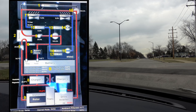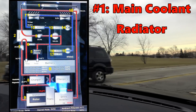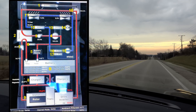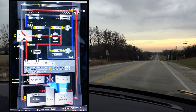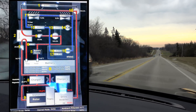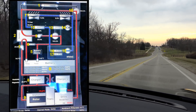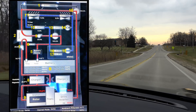First on our list is number one: the main coolant radiator. It does not have a fan. When the vehicle is moving, air passes through cooling the coolant. Coolant enters from the right. This radiator can be bypassed with device number 10. This is important as when temperatures are very cold, bypassing the radiator will keep your battery and motor from cooling further rather than warming up.